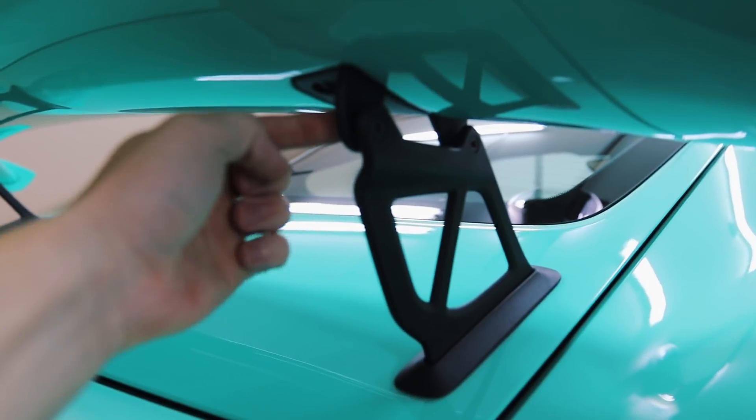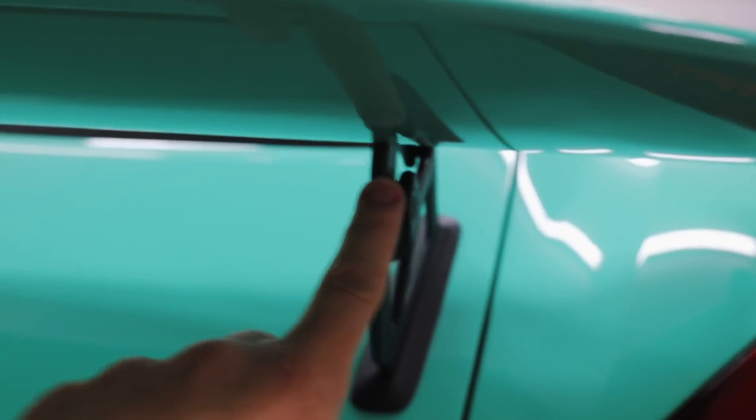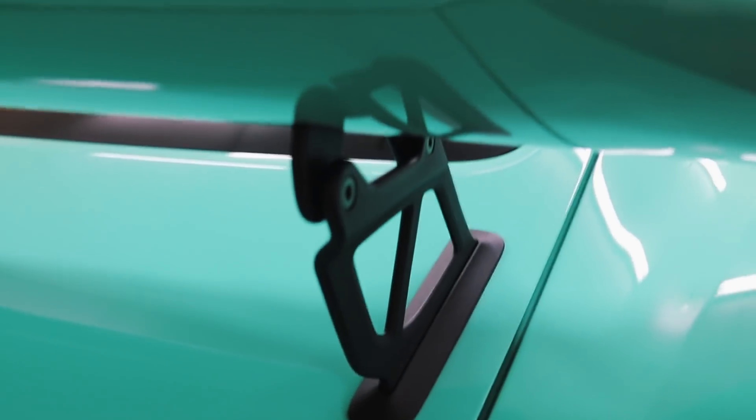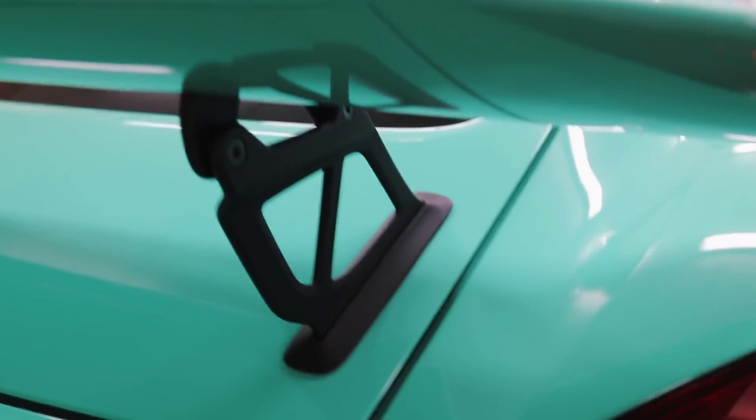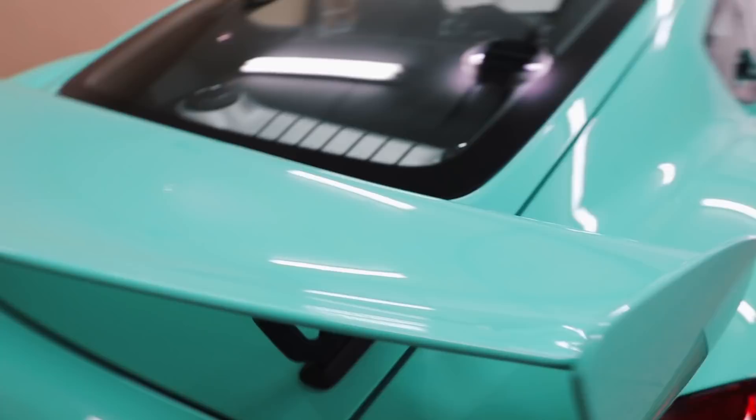Next step: close the hatch and pull out these two bolts — there's a T30 head on each side, and right in between there's a washer you want to reuse, so make sure you don't lose that when you pull these out. This install should be pretty straightforward — just take your time going through it. Once I get these off on both sides, I'm going to have a friend come over and help me pull the wing off because you'll need to lift it carefully. I'd recommend having a friend help you for that part.